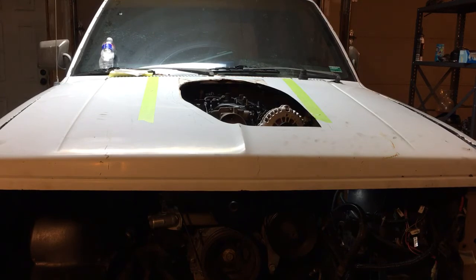I wanted you guys to see that once we properly mounted the rear of the T5 on the crossmember and shimmed it seven eighths of an inch - we don't know a hundred percent where we're at because the suspension has to be under load for you to properly measure your pinion angle and your output shaft angle - so until I can get this thing on the alignment rack up at Certified Cars, I'm not going to be able to get a real accurate measurement of my angles.